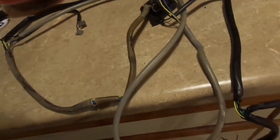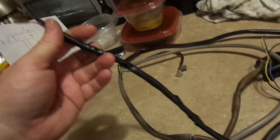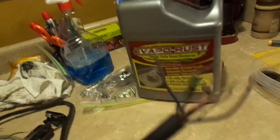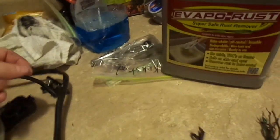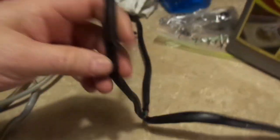Let's move on to the wiring harness. I'm aware I can buy a brand new harness for $35, but I'd rather save that and use it somewhere else. This section here looks like the wiring that goes to the headlight assembly, which makes sense because this section goes over to the switch block. There's the horn connection right there. There's a little bit of chafing on the outer insulation, but no damage to the inside wires. I think sleeving it with a little bit of shrink tubing will solve that problem.